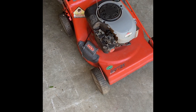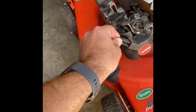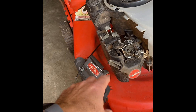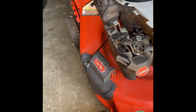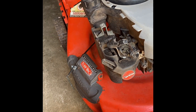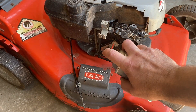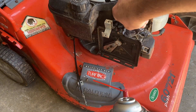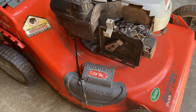What I'm going to do is take off all this stuff up here, because what that cable was doing was basically priming it - so I'll take off all this stuff and put a primer box on it that I took off a scrap mower. First, let's spray some starter fluid into it and see if it'll kick over. Previously taking the air filter off it was horrendous, so let's just do that and see if we've got some spark.